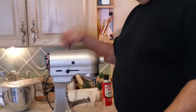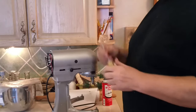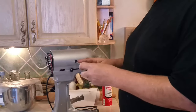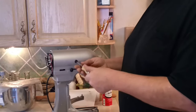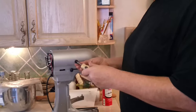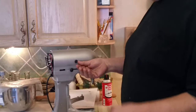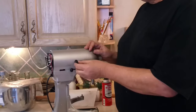So we're going to pull the plug. We're going to get a straight-headed slotted screwdriver, insert it into the brush holder cap, and twist it counterclockwise about three or four turns. While pushing pressure — if you don't want it to pop out, there's a spring behind it. If you're not careful, it'll pop out. We'll just carefully hold it, grasp it with two fingers, and pull it straight out.